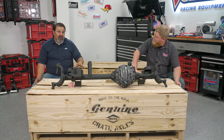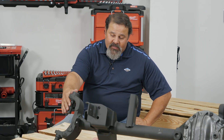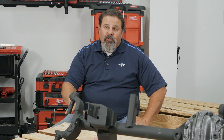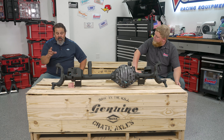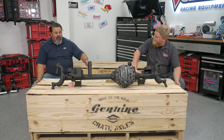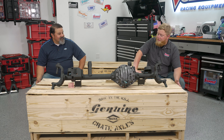It is a bolt-in, plug-in replacement for your Jeep JK, JL, or JT Gladiator — we have versions for each one. You'll notice it doesn't come with knuckles. You remove the knuckles from your current front axle and transfer them over, so the knuckles, hubs, and brakes all come right over to this axle. Then you've got a bolt-in plug-in solution that works with your ABS and traction control with no lights on the dash. That maintains all the creature comforts.